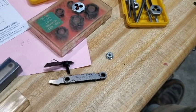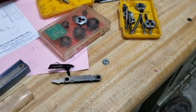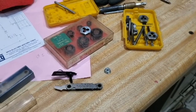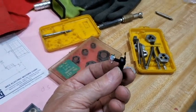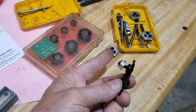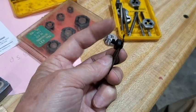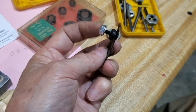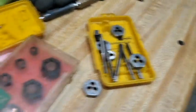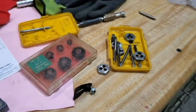I'm glad I didn't try to do this on the car — I would have been very frustrated. I always try to dry fit everything together, even simple things like a nut and bolt. As I suspected, the stud was the problem. I ran the tap down through the nut and it went very easily, and the die took a little bit of effort on the stud, but now everything is free and going on there. The importance of dry fitting saves you a lot of hassle, and luckily I had a small micro tap and die set and a thread gauge to sort it out.